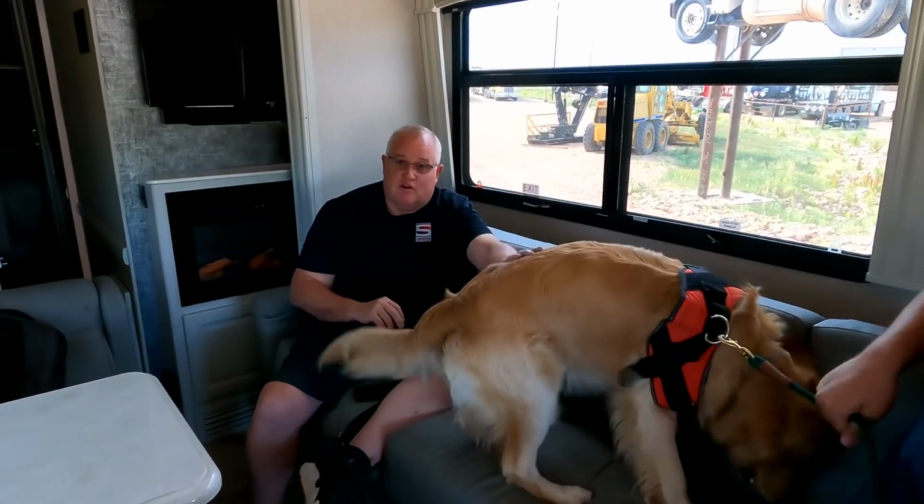All right, time for Jen to hop in the driver's seat. Wayne, how would you say that felt overall? It really, really felt amazing. It truly felt like driving a diesel with a nice air ride suspension and everything. Now, Wayne, this has the 4-point on it. What's the difference between the 4-point and the 2-point? So this has liquid spring suspension on both the front and the rear. The 2-point is rear only. This one has 4-corner, which is what Fleetwood offers on their coaches.